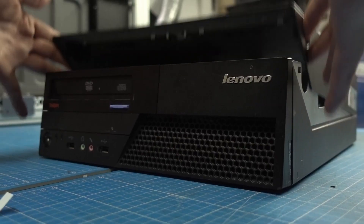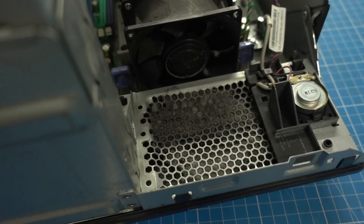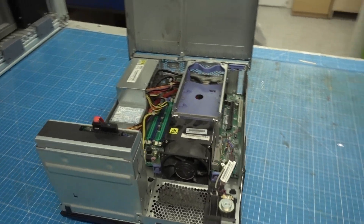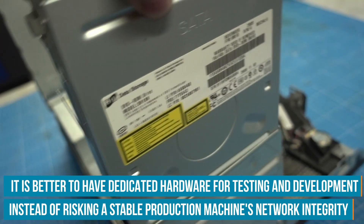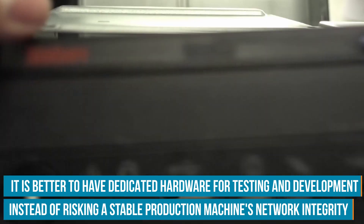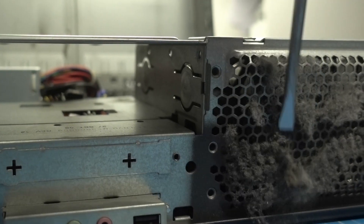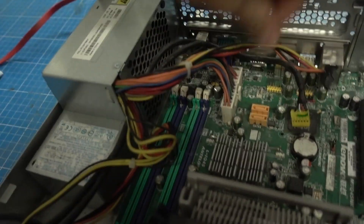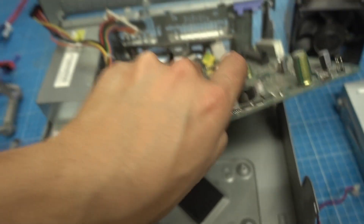The old business PC is a modular design that is very fast to open and to exchange parts, which is great because I can basically on the fly exchange parts for my experiments and projects. I often use a Pi-based router — just a bare Raspberry Pi in Wi-Fi access mode — to test Wi-Fi projects and gadgets. But managing passwords and having everything set up without risking my own network is a problem, so I'm making a dedicated machine. With the modular approach, I can exchange hard drives, Wi-Fi dongles, and whatever else I want on the fly without removing a lot of screws.